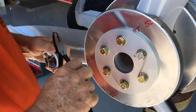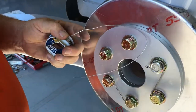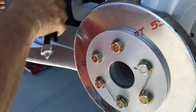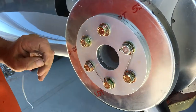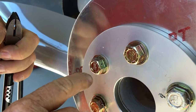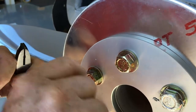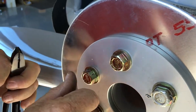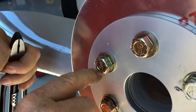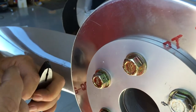What we're going to do first is measure the amount of safety wire we're going to need. We're going to turn this to get an approximate length, then cut our safety wire right here. You always want to run your safety wire in the direction the bolt has to be turned in order to tighten. So if I'm going to use this bolt right here, I'm going to go this way around here, through here — that will be the plan.